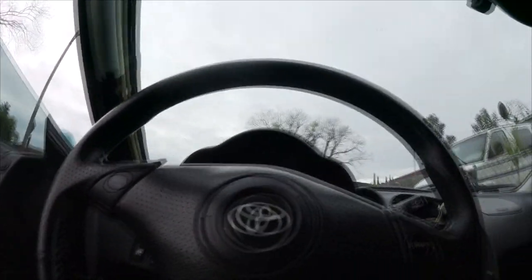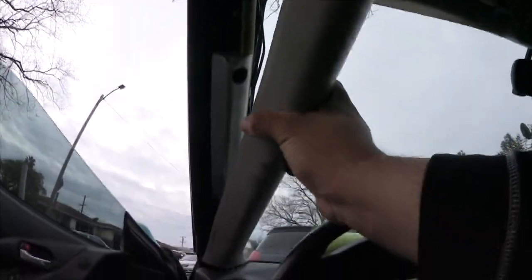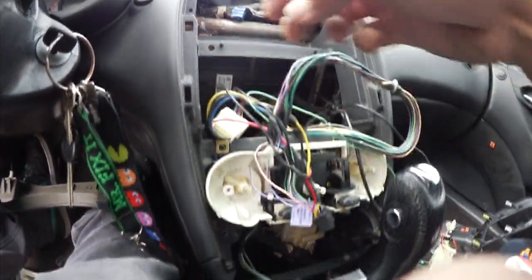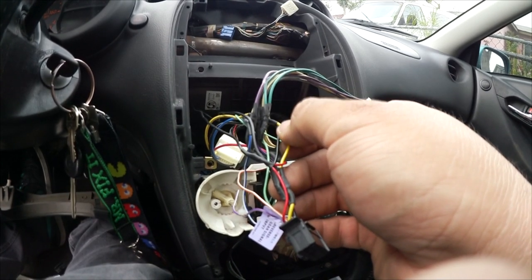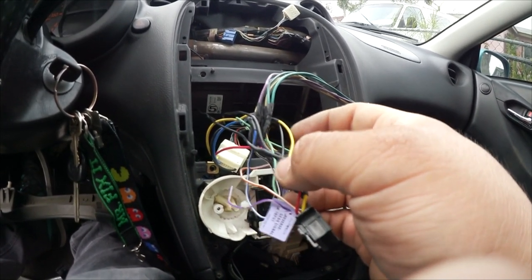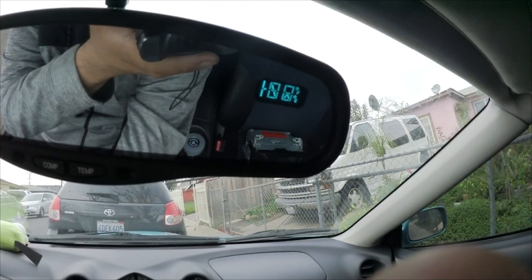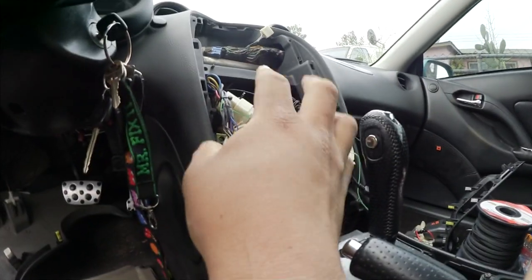That's what I got from the junkyard and that's what I'm putting on. You can put your light back on, tuck the wire in, finish zip tying it, and your pillar cover can go back on — very easy. Make sure the weatherstripping is on the outside. I finally got the rearview mirror wired up: the black wire is ground, the yellow one is the 12-volt constant, and the red is for ignition or accessory. Check this out — it's off right now... there it goes, awesome!